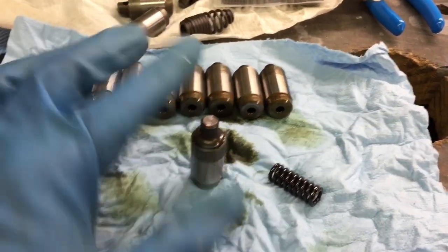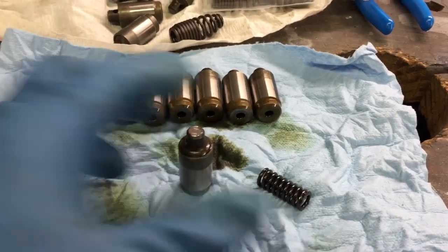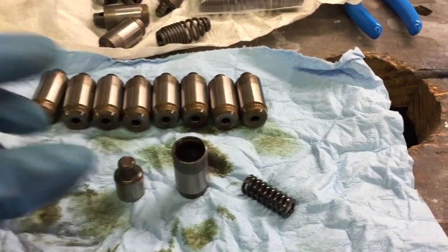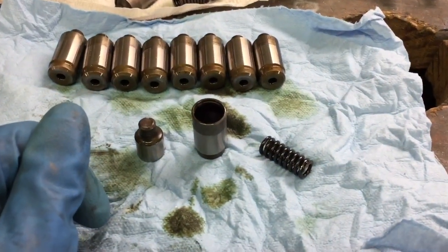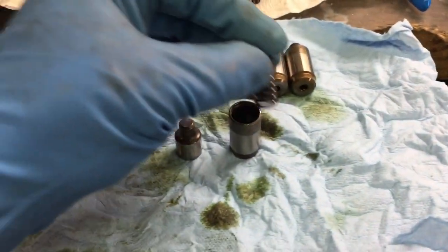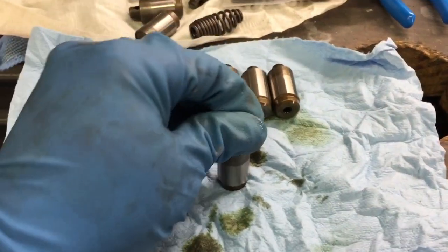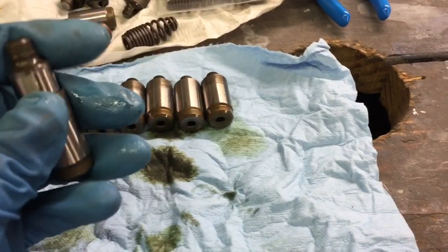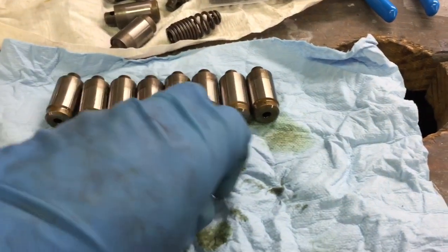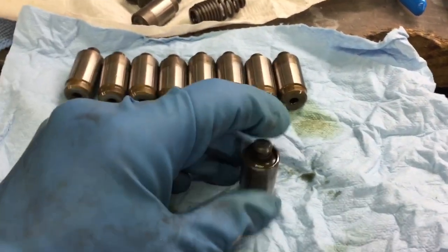This spring, along with the help from the oil, works this lost motion assembly. So when the VTEC rocker comes up, pushes down, when you're not in VTEC, this helps keep that rocker from flopping all over the place and making a whole bunch of noise. So I'm replacing this three piece, which usually ends up making some nice little chattering noise, with this thing again. Darn it, one-handed stuff. Oh, there it goes.